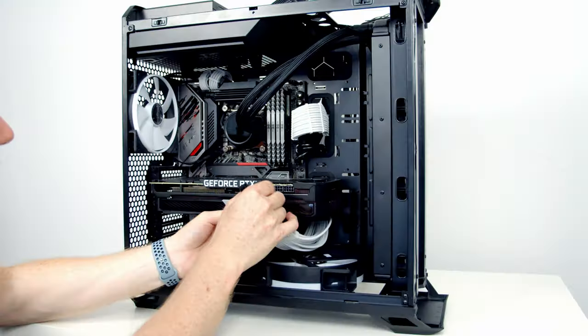So how did this maximum CPU temperature of 80 degrees compare to the three other builds I've done using the i9-10850K? So I've done builds in the Antec Dark Cube, the Antec P120 Crystal, and also the Meshify 2 Compact. Now obviously we can't do a like-for-like comparison because a lot of the other components were different. So taking a look at the temperatures in each of the three builds using Noctua's NH-D15, they were 86, 91 and 88. So in this case, with a temperature of 80, it is clearly the winner. It was only in the P120 Crystal that I used the same GPU.